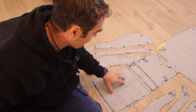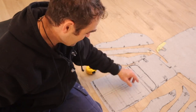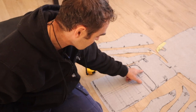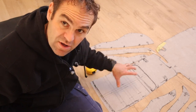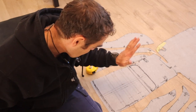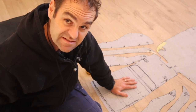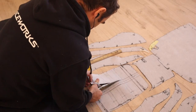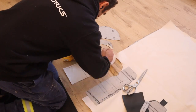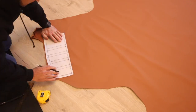I did some rough sketching to get a ballpark of the Daytona layout. The lines aren't in exactly the right spots but I know what I need now. I need to cut out this curved section — the Daytona panel will be a separate piece, the top bit will be a separate piece, and there will be one bit for each side plus the center rib. I've added a gap all the way around the edges of my pattern — a 10-millimeter seam allowance on the inside edge, and a bit larger on the outside edge since I'm not sure exactly how big it's going to be yet.